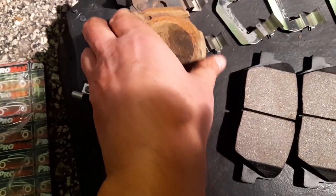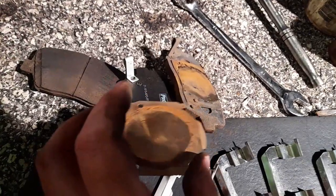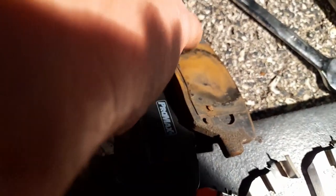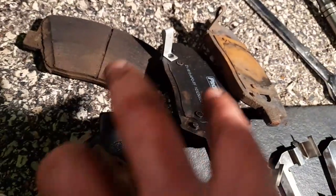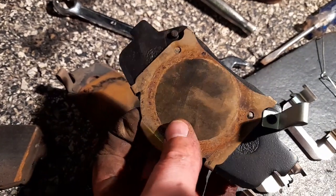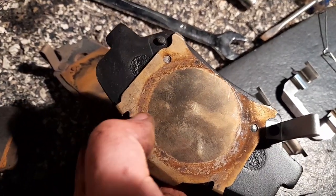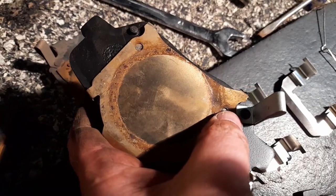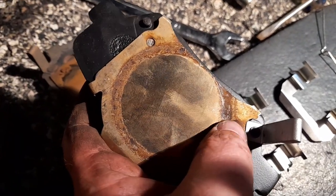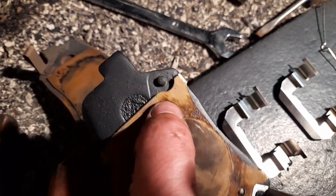I need to check if that little bracket fits. I took the plate off the old one — it actually fits the old bracket because the new bracket holes are much smaller diameter. This one is much bigger and doesn't sit down, so I might have to re-drill them. I'm not gonna use that new bracket since it doesn't fit. The piston goes right even beyond so I'm gonna file it a little on both sides just in case it hits, since the new holes are much smaller.